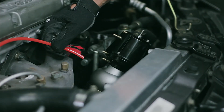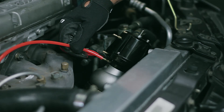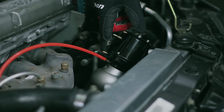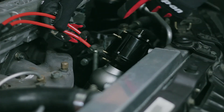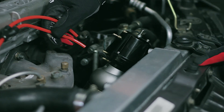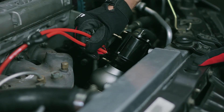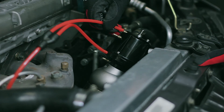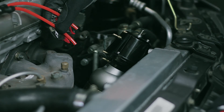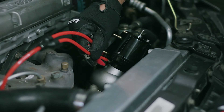The next highest boost pressure is made by applying only one signal to port C. To go another step higher — say from 10 to 12 pounds — move the boost source from port C to port D. To keep it simple, we're only going to work with two boost sources to open the wastegate. To get the next higher boost level, apply boost to port C and also to port A, which keeps the wastegate closed.